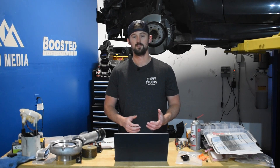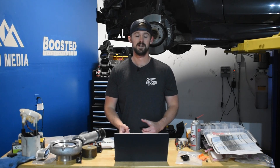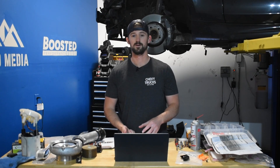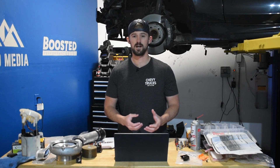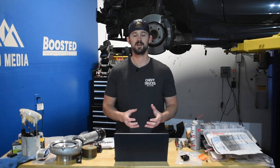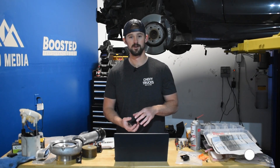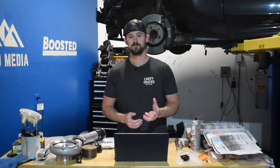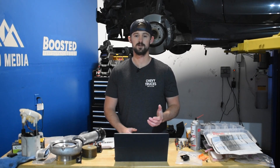At the end of the day, this is actually a really reliable engine. The only real problems with the LMM are with the emissions system. We're not going to tell you to delete them, but if you do, that makes for an extremely reliable engine with reliability levels virtually similar to, if not better than the LBZ — so long as you're not throwing a crazy amount of power at the engine. To boil everything down to one line: we have an extremely reliable engine with a couple of unreliable emissions components. That covers it for our video on the Duramax LMM. If you appreciated this content, hit that like button, subscribe to the channel, and stay tuned for our future Duramax content.